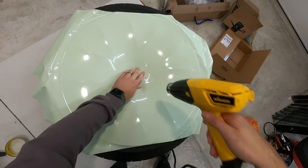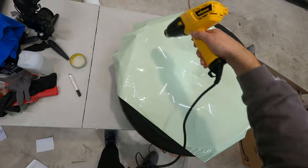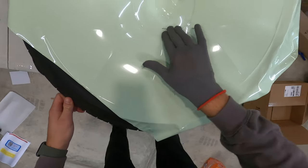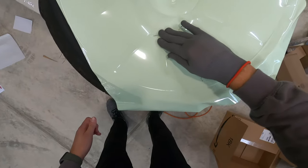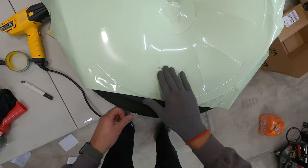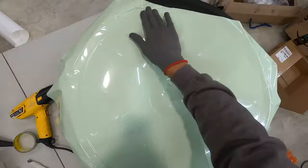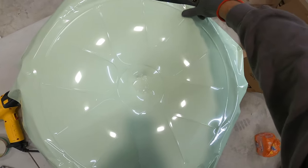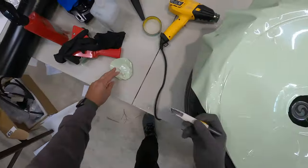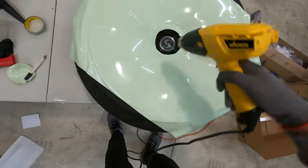I'm softening the vinyl up even more — stretching it right down to the middle and tucking it there. Now that it's all warm, I'll put the glove back on and follow the channels, pushing all the way down to the bottom. Vinyl is pressure sensitive, and the cool part is we don't have to worry about doing any damage to the rim whatsoever. I'm going to take the knife, poke in here staying away from where the line is, and remove the material. Heat this up — see how it shrinks a little bit and the hole gets bigger.